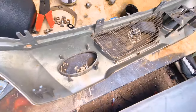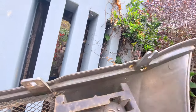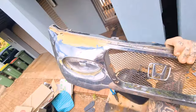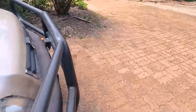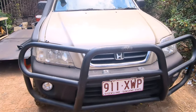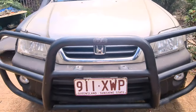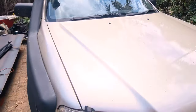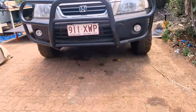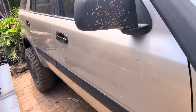It came with the Honda emblem and I can't see IPF branded anywhere on it — very intriguing. I have the other fog light lens as well. The reason I pulled the grill off was to find out what bulb type the fog lights use — turns out they're H3 halogen bulbs, which are quite dim. I'm currently figuring out an HID conversion for them. When I paint the whole car that'll get painted too. For now I've got the old grill on, and I still haven't finished the high-flow air box mounts, so the snorkel isn't piped up at the moment.